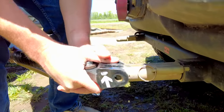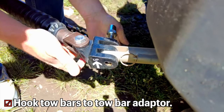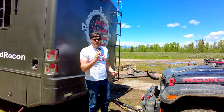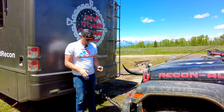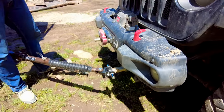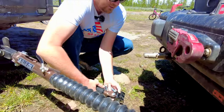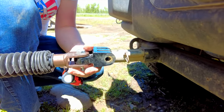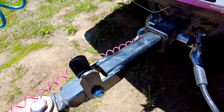To counter that, Blue Ox has sent us these awesome stainless steel locks that go in each Blue Ox fitting so they literally can't unhook. Put that through there. Make sure you check with Blue Ox for your specific mounting system because they are vehicle specific. Put our lock back on — arrow is pointed up, flat tow locks are secured. Do the same thing on the other side, make sure your arrow is pointed up. We've also got a Blue Ox lock on the front.